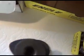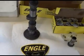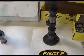Let's take a look at some of my concerns. The difference is obvious looking at the profile of the cam lobe. Look how peaky that lobe is on this one, and now look at this — it looks a little softer. There's a reason for that: the one with the high sharp peak versus the lower rounded peak — the one on the right, when set up properly, will actually lift higher.